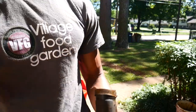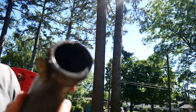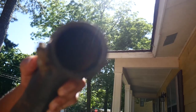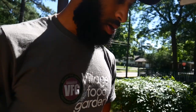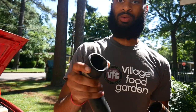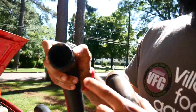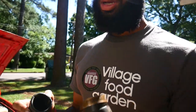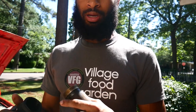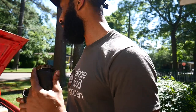I want you guys to take a look at the difference inside these hoses. This one I just pulled off — you can see all the soot and dirt in there. This one I just cleaned — all the way down it's fully black-clean, got everything out. What I did was pull the hose, ran some water through it on high pressure, and cleaned everything out. I'm going to do the same for this one and probably pull the radiator and flush it out the same way.